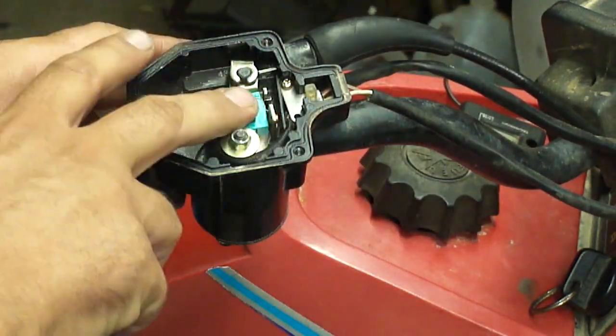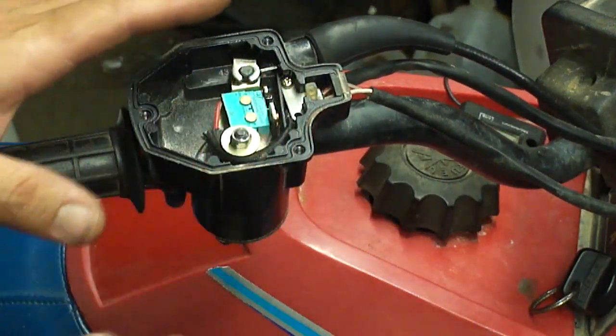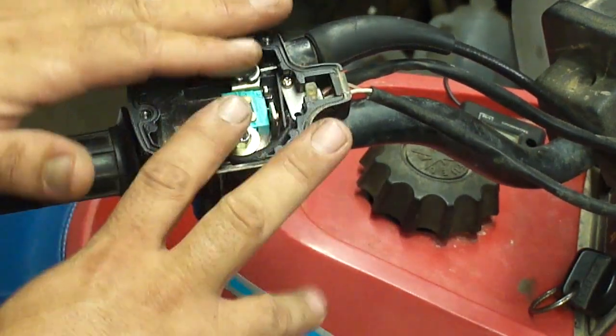To the best of my knowledge, all these ETC systems work in a similar fashion. There seem to be a lot of people having trouble with no idle, and a lot of people's first suggestion — other than the carburetor of course — is that the ETC switch is not adjusted correctly. Really, it shouldn't ever kill the engine; it should just limit it to about that 1100 RPM. I would say that's not going to be a problem, but I'm not an expert and there could be some models — like the newer 98-plus models — where if this isn't functioning as demonstrated, then either the switch is bad or something's unplugged in the rev limiter system. I would recommend making sure this works correctly.